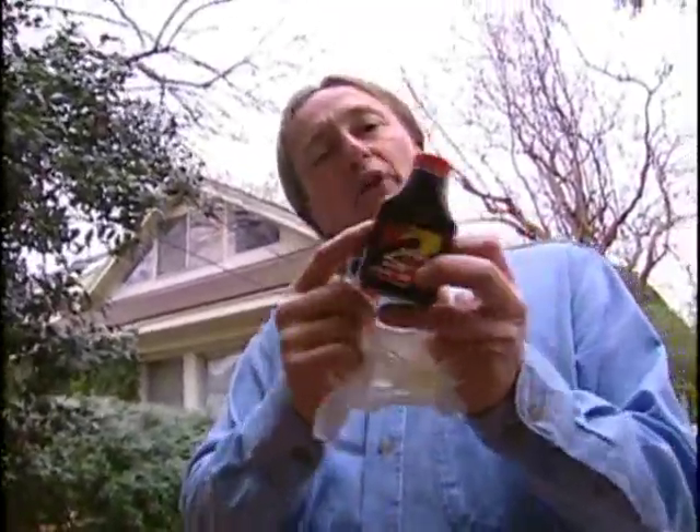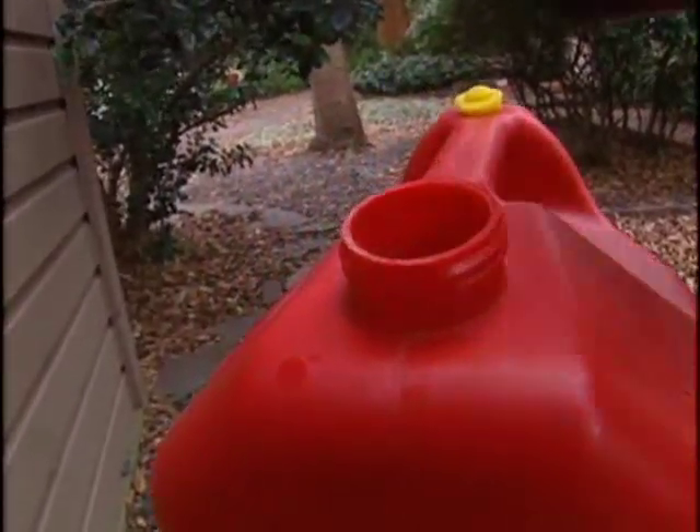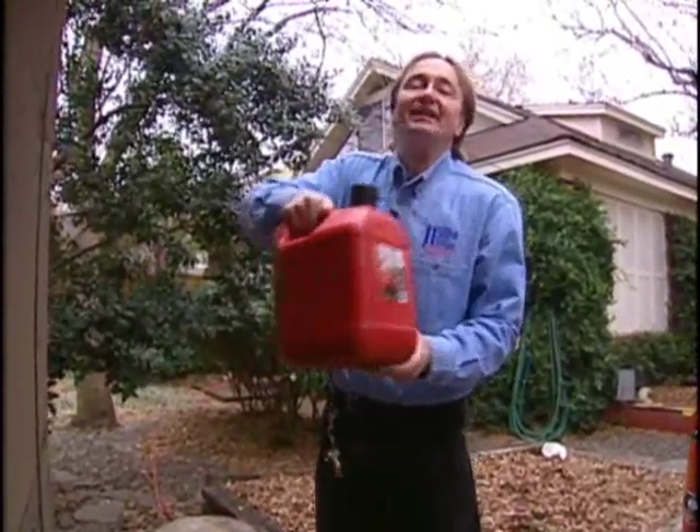It's easy to get that mixture. You just get one little bottle of this 40 to 1 oil — it says on the back it's for one gallon. Put a gallon of gas in the tank, then take the top off and pour the oil inside. Then shake it around to mix all the oil and gas. It only takes about 30 seconds.